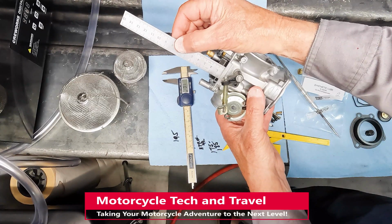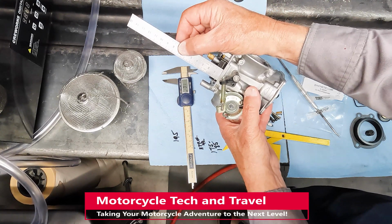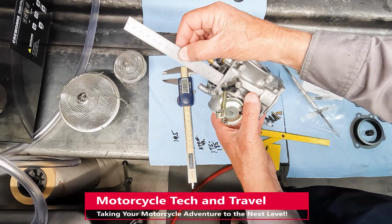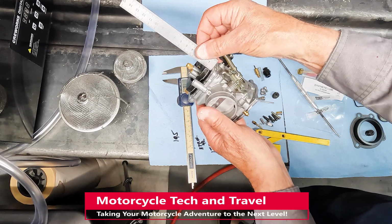Here's the third method, using a quality straight edge. Again, the carburetor is tilted, and the measurement is to the top of the float. For an emergency roadside repair, simply making the float parallel to the face of the carburetor is sufficient. You can readjust the float accurately once you're safely home.